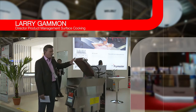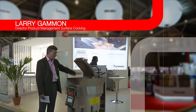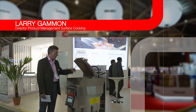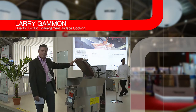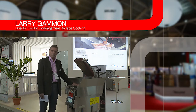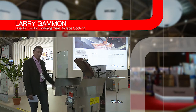You can see on the upper unit that we use Teflon, and the reason for that is so that the product does not stick to the upper platen, so the product stays onto the grill plate. Teflon is very easy to clean — you do that every night with soap and water and reattach it. Then you clean the grill plate similar to flat grills, and we have a couple of grease traps that you can then take and empty all of the grease into the kitchen.